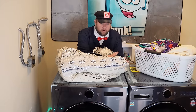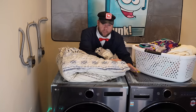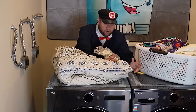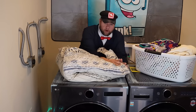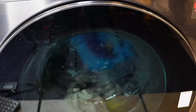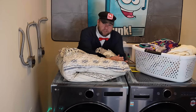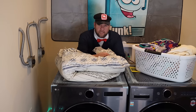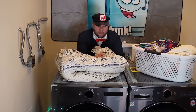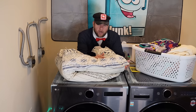We've gotten through around two dozen dries on this machine, as well as legitimate wash and dries — not just throwing dry clothes in and forcing it to run. These have been almost two months of washes if they were at a house. Drying times have been as low as about one hour and 20 minutes on a small load. The average 11.5 pound load comes in at about one hour and 35 minutes. Bedding and towels are quite a bit worse. My impression is the drying times are a little bit longer than expected from a dedicated 220 volt heat pump. However, the huge difference from the 2-in-1 combo and the GE ultra fast combo is that when you pull the clothes out of this, they're actually fully dry — bone dry, like they came out of a tumble dryer.